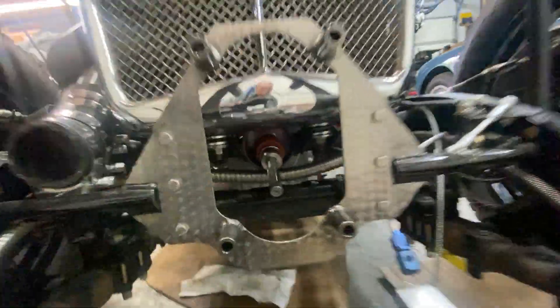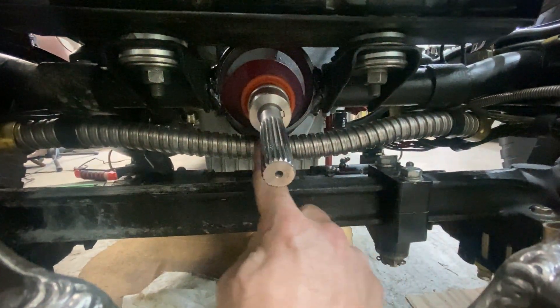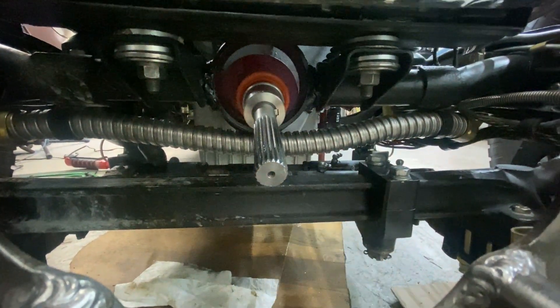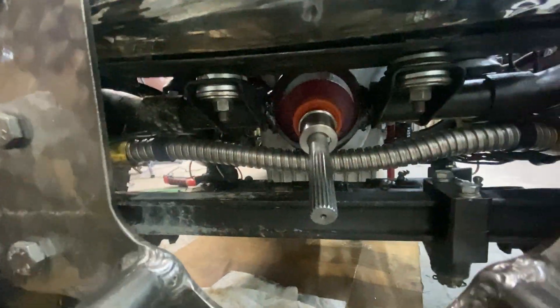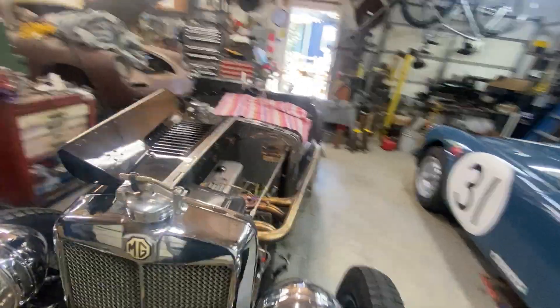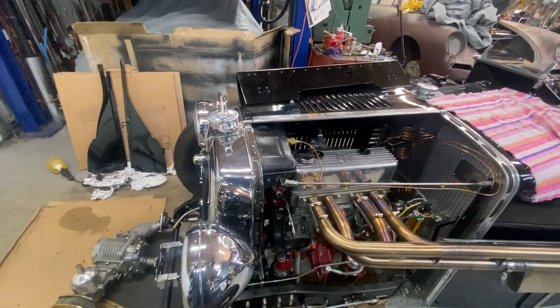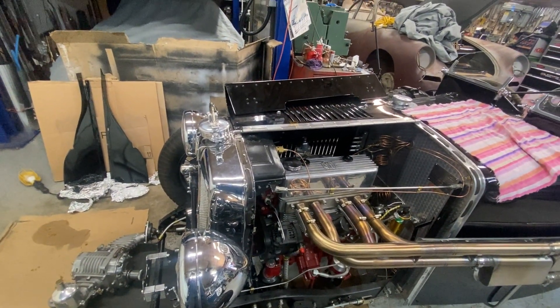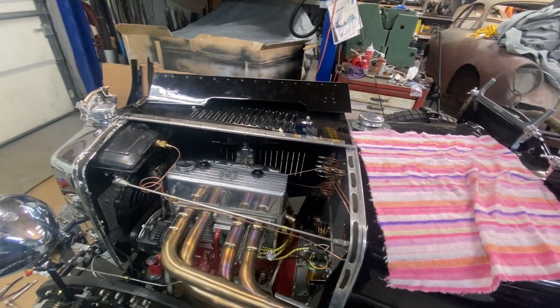In the process of welding in this new surround, we ended up straightening out this cross member. So the big shim that was required to correct the factory misalignment on this mount is no longer needed. It turns out I needed a tiny one on this side now. Once I did that, all the bonnet gaps aligned nicely. It could be differences in the rubber mountings because one of them under the radiator was squashed on the other side — hard to say. But anyway, you just shim it until it looks right, and that's what we did here.